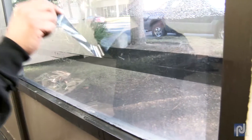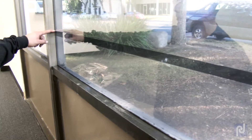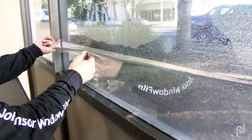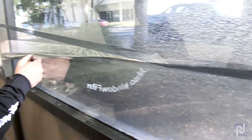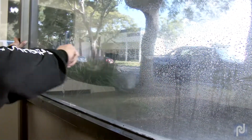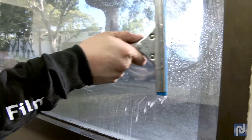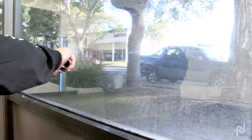Remove the top layer of film scrap. Then carefully peel back the corner of the pattern with scrap under it. Gently peel out the scrap and simultaneously mist across the splice while pulling out the scrap. Squeegee over the splice gently, removing any water. Be careful not to catch the splice and crease or tear the film while squeegeeing. Follow the squeegee splice pattern shown here.